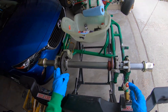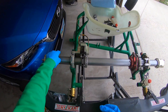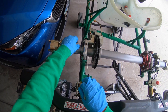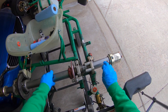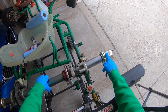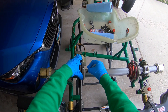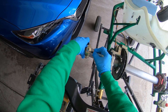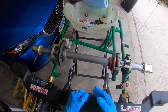The first step is to mark our hubs and brake holders — especially the hubs on both ends. As you can see, there's already a line here because I removed this rear sprocket once before. We're going to mark that so when we put it back together we know where to stop — where this hub and brake wheel hub need to go. You can never have enough marks, right? This ensures that when you put it back, you know where it needs to go.